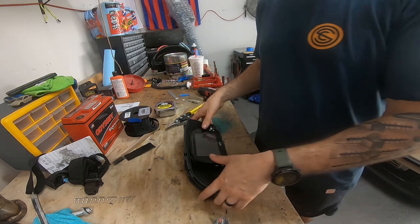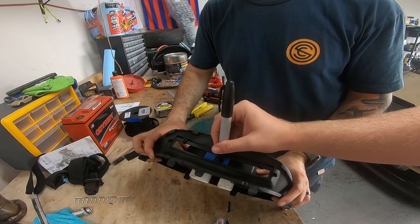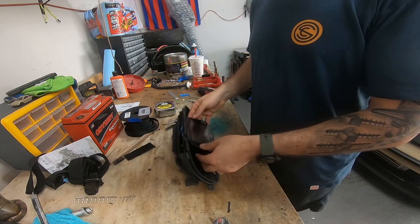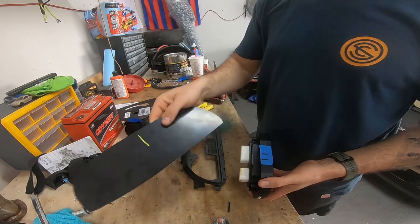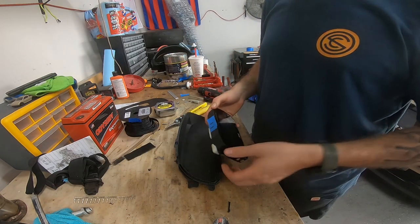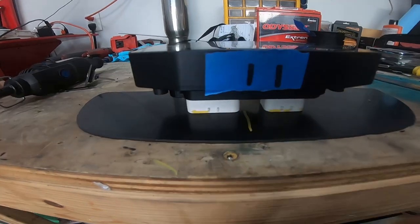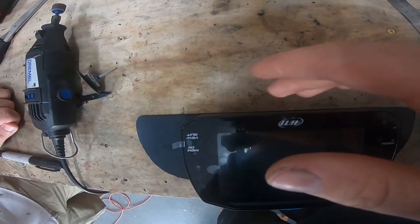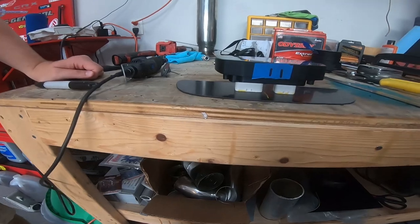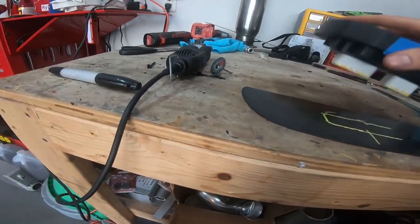There's a sharpie. So now as I hold this centered with the tape, we're just going to mark both sides of it. We're going to take that over to my brand new piece that we just made - drew a line there for the center again - and I'll be able to transfer this over. So there's the blue tape, two of the lines we drew for the center of the housing. That's the other mark we went down from the housing - just line them up in the center. We made the bottom of the AIM dash flush with the little plastic we drew.